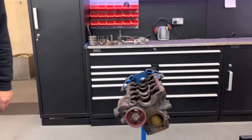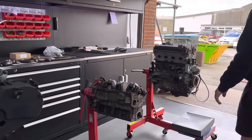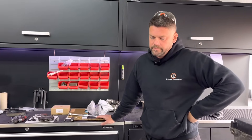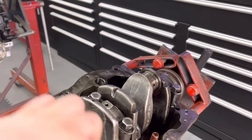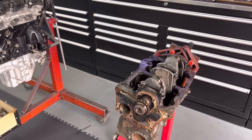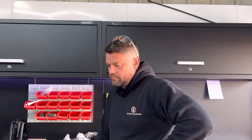Hopefully something can come of that in the next week or two. This is the little A-series — he'd already taken the head off and took a piston and rod out, so I'm just stripping what's left of it. This is just a go-through. It looks like this journal here is not very good, so the crank could need grinding — probably needs grinding, hopefully it's not bent. Customer's bought most of his own bits — he's got a lot of bits. He's a decent bloke, this customer, buys the decent stuff. We don't mind that really. Just quite a simple little A-series, turn that around fairly smartish.